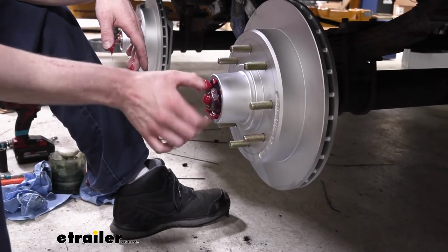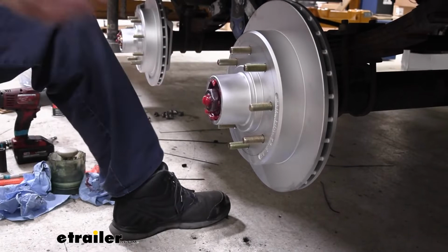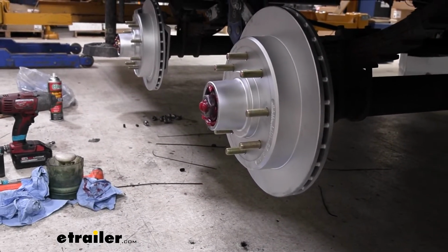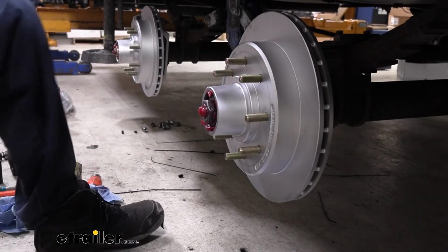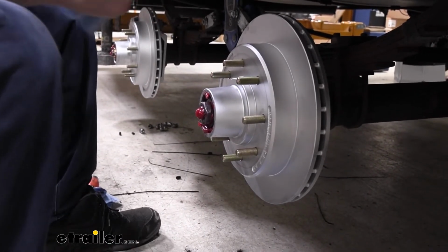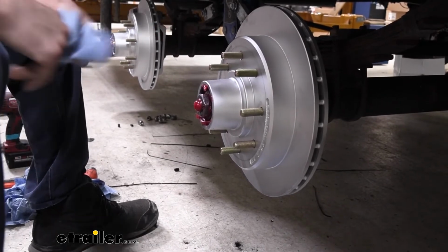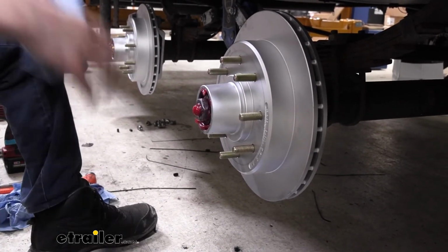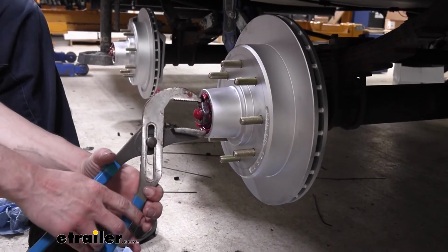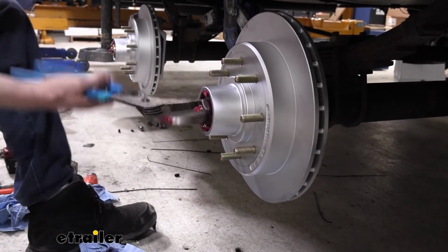bearing preload. We really don't want like any preload on it. We kind of want it to be at a perfectly balanced state where there's not excess pressure on it, but it's not too loose. And I'll kind of show you the way I like to do it here. This seems to work out pretty well in most instances. I'm going to switch back to my channel locks. We're going to grab our nut here and we're going to tighten it down.